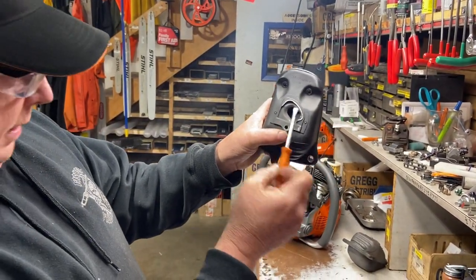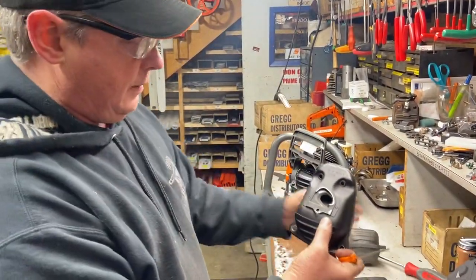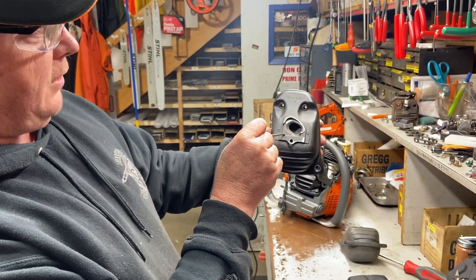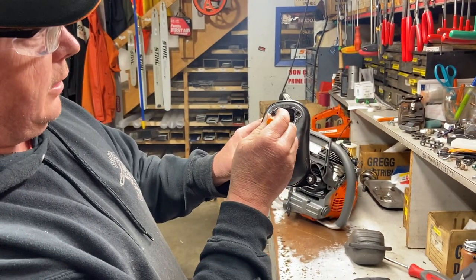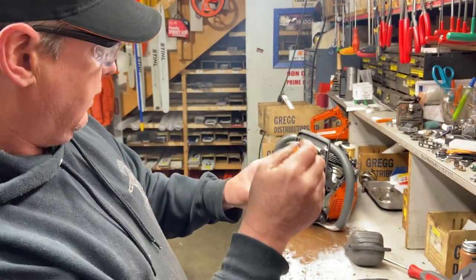This one I've cut the top off, as you can see, with the stock one. So I take my torch and put it on a real hot fine setting with my fine tip, and I cut all this stuff out of here in the front and back where it comes out of the exhaust part. So then you get a fairly good straight shoot down to the new opening that I do.